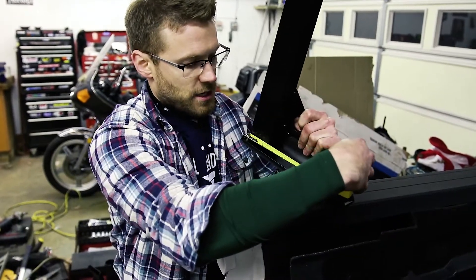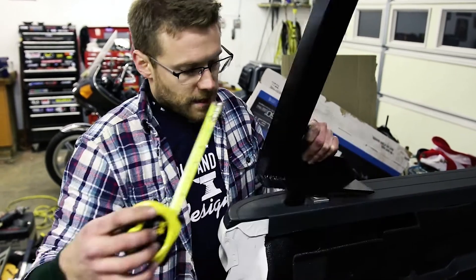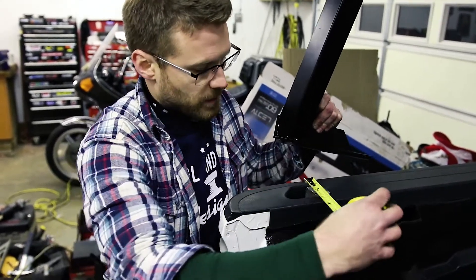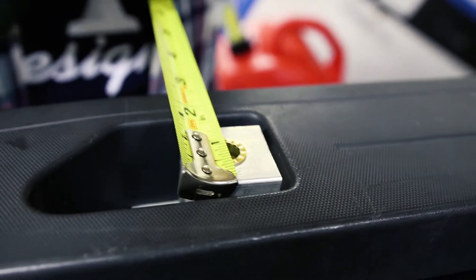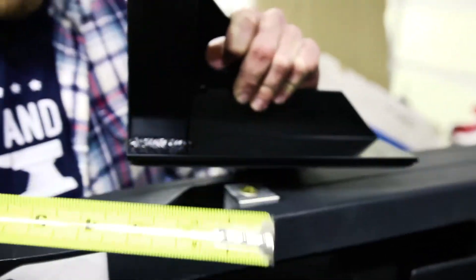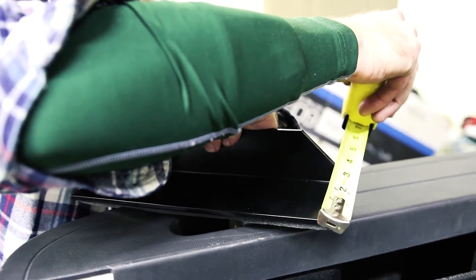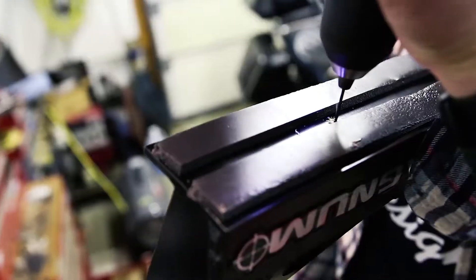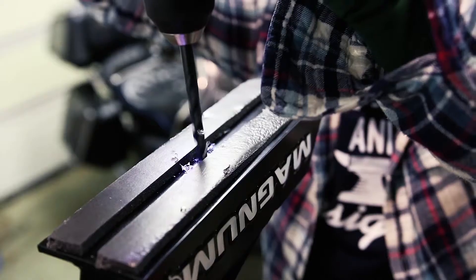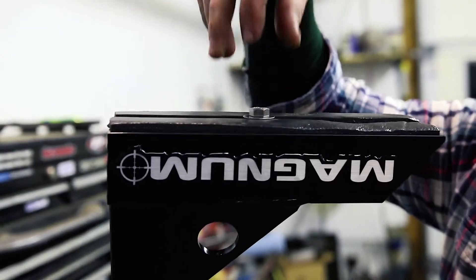So from the front edge, I want to install it four and a half inches back. You can do the same for the distance from the inside of the bed rail — I'm at two and a quarter inches, again subtract about three-quarters of an inch, and you want that to be an inch and a half from the inside edge. We went ahead and marked it on the bottom of the rear rack and we're ready to drill. The final drill size we're going to go up to is a three-eighths bit — and as you can see, that fits right in there.